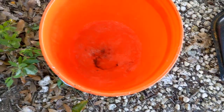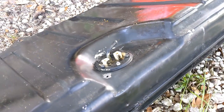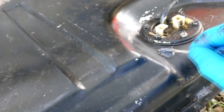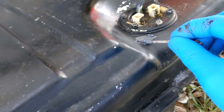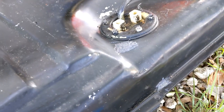A lot of crap came out of that gas tank. Because I only need a fix to last a few months, I'm just going to use this JB Weld epoxy to plug up the gap, and that should give me a few months until this thing goes pure electric. The annoying thing is I had everything I needed to plug this gap with me in the car, but I thought because the tank was half full, the leak was on the bottom half. If I'd only looked when the tank was full, I would have noticed this. But we live and learn. Put it on nice and thick — that's going to take about 6 hours to cure.